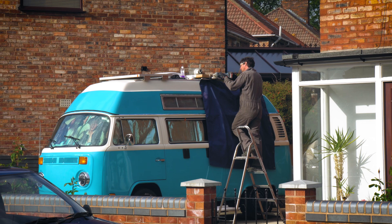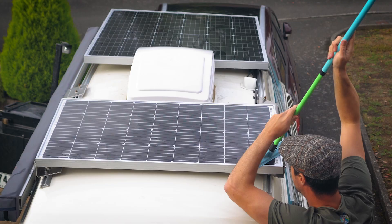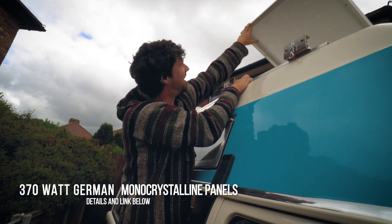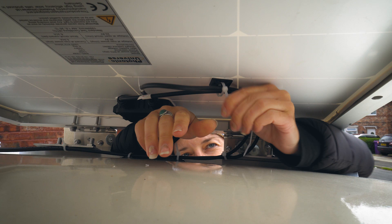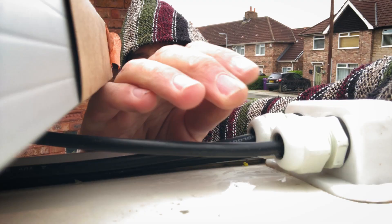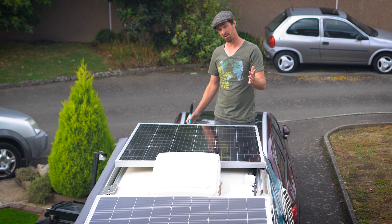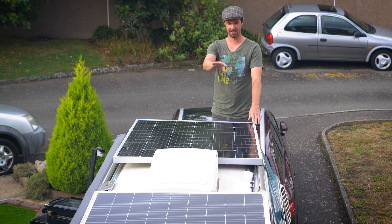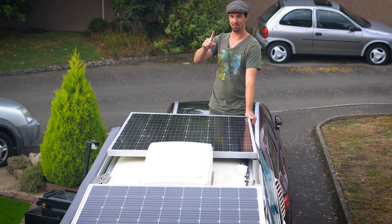Our panels are heavier but allow us to cover more surface area, and at some point we'll be able to tilt them — particularly useful when traveling near extreme high and low latitudes and during winter months when the sun is lower in the sky. We have two fixed panels: 250 watts on the rear and 120 watts on the front, for a combined total of 370 watts. For optimum performance we chose German monocrystalline cells, which are better at handling high temperatures, and since they're from the same manufacturer with the same date of production and voltage, they work extremely efficiently connected in parallel. With parallel panels, if part of a panel is shaded you only lose part of the power, whereas in series you'd lose much more.